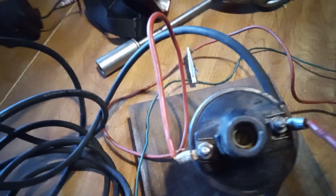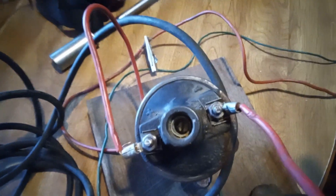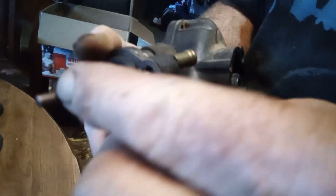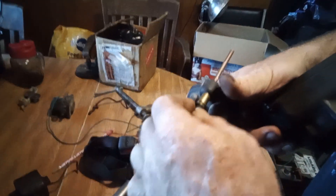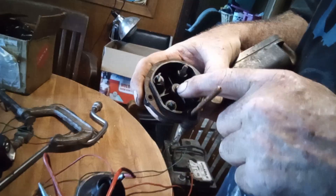For what I did — every Delco coil, if you can look down at the center of that, right down in the center of that hole, see that screw in there? Screw in the brass piece right there — I took that out of a Delco coil. Your magneto signal sends it through here and it'll come down to the center of this deal. I just drilled a hole on the outside and screwed that in. And what that'll be for is my coil wire — it'll fit right there. You can put a boot over that and some silicone around it. That gets the spark from here to the center, and your little rotor sends it out to each of your four cylinders. It's real simple.